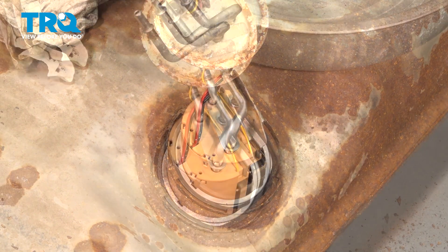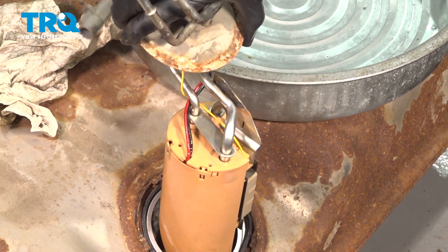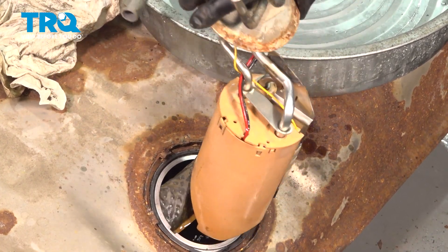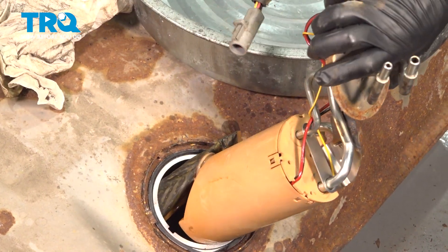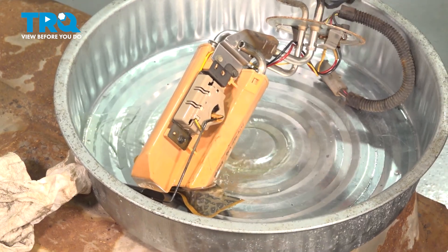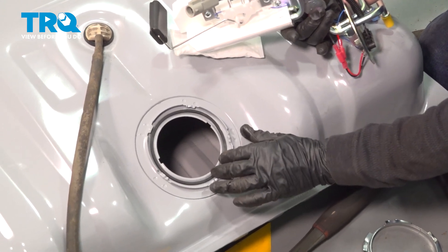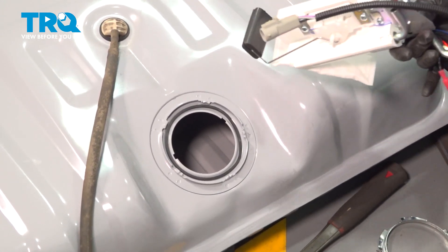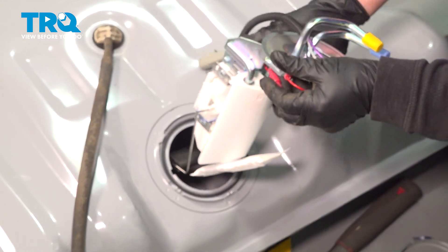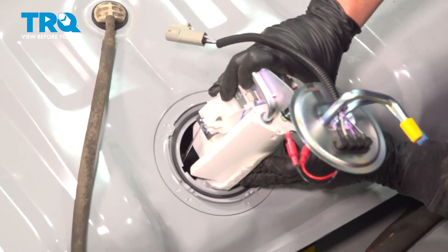I've got my basin pan here. I'm going to lift this pump up, take it out of the tank, get past that pickup screen, and let it drain in the pan. Before we put our new pump in, we've got our new seal — we'll line that up, make sure it sits perfectly and not overlapping. Now we know which direction it sits. I'm going to guide my fuel level sensor in and get that sock filter pickup screen.